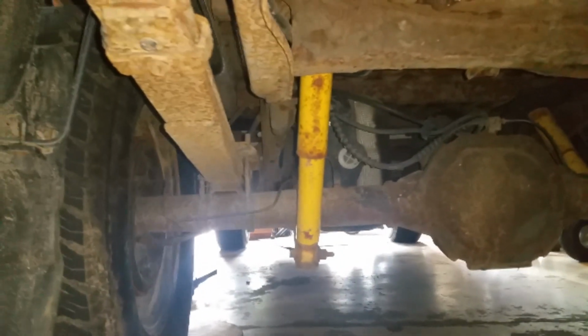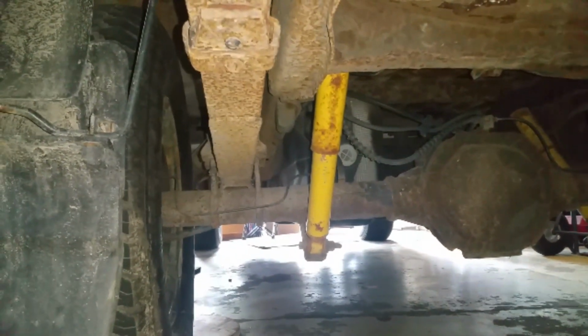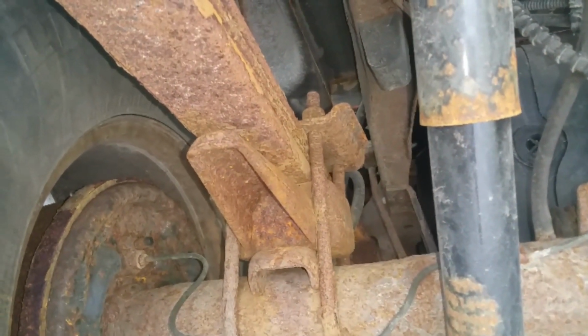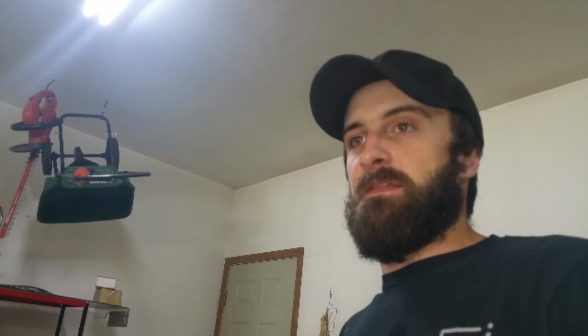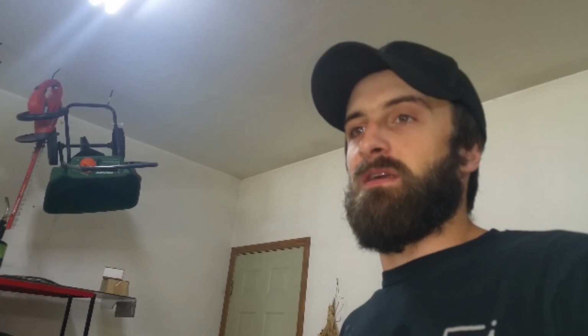So you can see under here, I'll take those U-bolts, pull them out, and then I'll move them over here on this side. This side has this big block in there. I'll pull that block out, put the different U-bolts on there, and that should be good for the back end. That block in the back is like 2 3/4 inches, so that'll bring the back down 2 3/4. And then I'll bring the front down like another inch just to get it level with the back end, but that should be completely free and it shouldn't take that long.